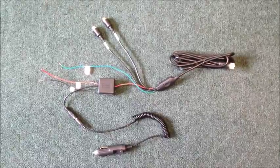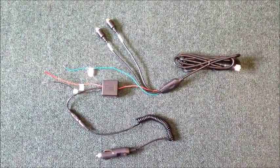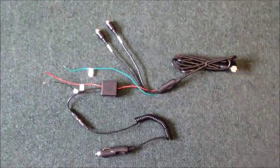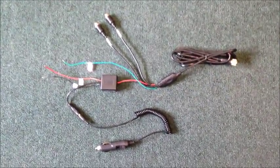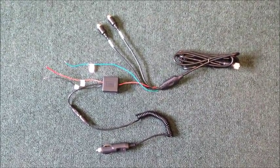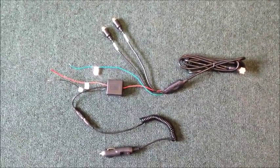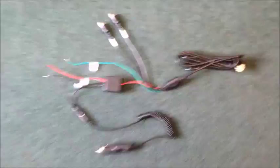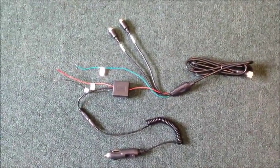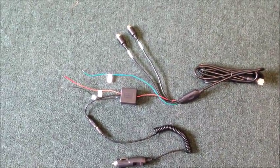In this section we're going to talk about the electrical installation on a seven-inch monitor. The main connection from the monitor to the harness is critical. For the electrical hookup you have two options: the first is your cigarette lighter adapter. Please use one or the other — either hardwire the system or use the cigarette lighter adapter. If you're hardwiring it, you're going to have a black, a red, and a green wire.